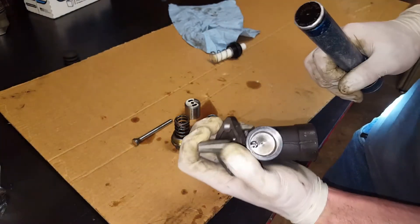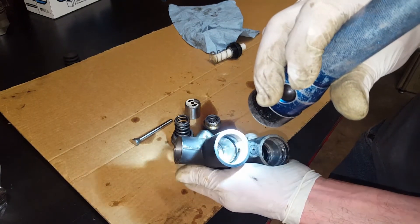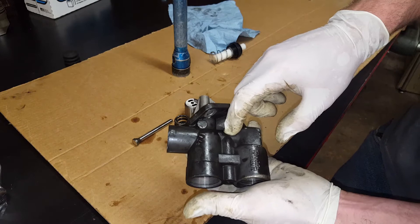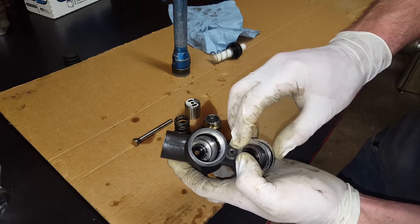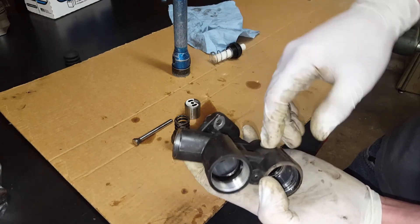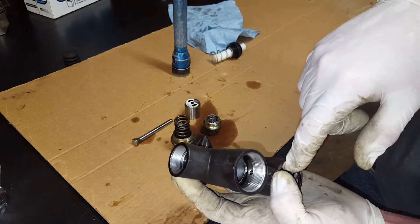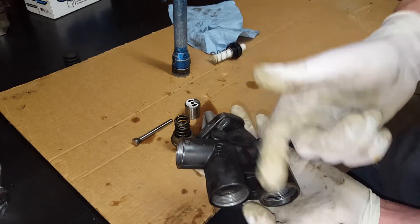This is where the fuel comes out at the top at that little hole. But if for some reason there's a blockage in the system, there's another hole on the high-pressure side in the back on the bottom, and that goes down and over to your high-pressure relief. If you took this plug out, there'll be an O-ring seal and a spring in there, which you can adjust the blow-off pressure from. It's a safety valve — if you kinked off the return line or something like that, the fuel is going to go back into this hole. It's a little ball, a spring, and that plug.